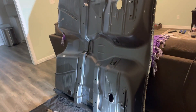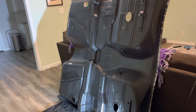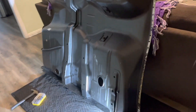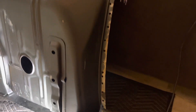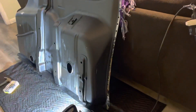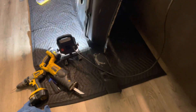I'm just doing this by myself, so I decided to cut it all apart. I know I said I was going to try it in one piece, but if it needs any kind of trimming, I'm just going to have a headache trying to cut it. So I've already cut the rear seat pan off. What I did was I drilled out all the spot welds from the top of the floor pan down — like you're sitting in it in the car — probably 20 or 30 spot welds. Then I drilled out more, and I've already taken one of the rockers off.